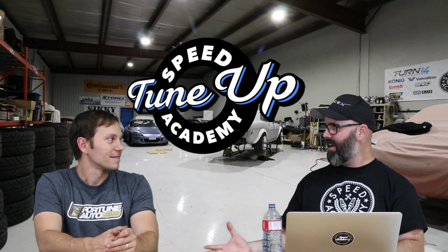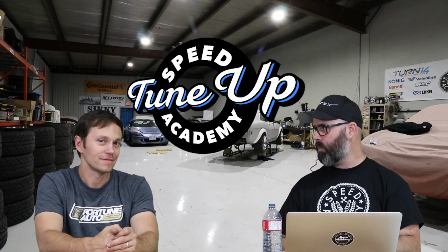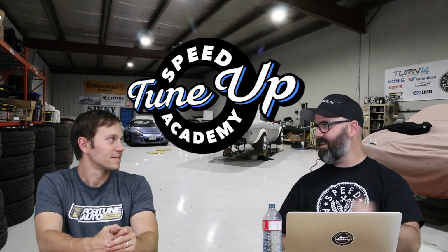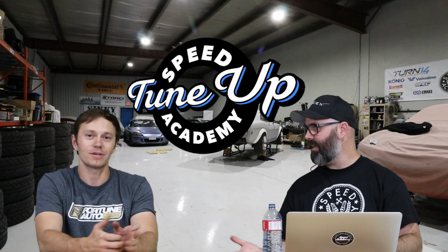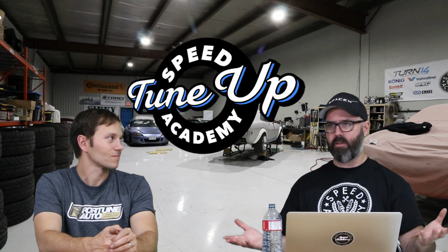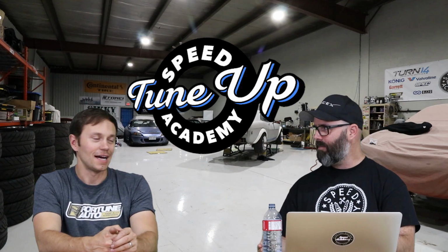But we sat there long enough, and the van cooled down enough, and then the sun set, and temperatures dropped pretty dramatically, and we're like, let's give it another try. So we reset the ECU, which we were having to do the whole trip because the thing would go into limp mode. Yeah, basically. Once it would go into limp mode, you had to pull over and reset it. So we would reset it, and suddenly the transmission would be happy again. So I think maybe the TCU was going into limp mode. Yeah. Maybe the ECU was.